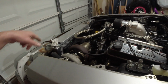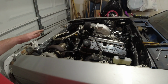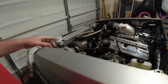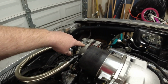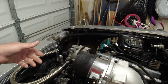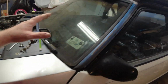Don't have the headlights wiring in just yet. Should not have any issues with that. I'm actually going to use the old wiring harness from the hatch. I know it works fine, but I need to modify it. I need to take all the old alternator wiring out because I'm running a different type of regulator, so when you start the car, it automatically clicks the alternator on. So it doesn't rely on the dash or anything since we run the Holley dash in it.